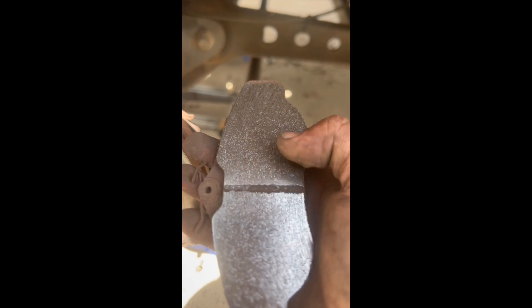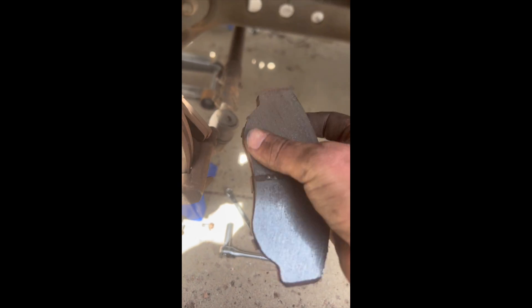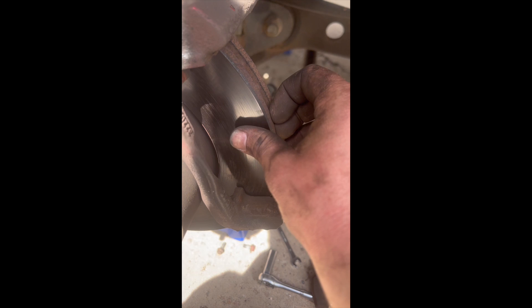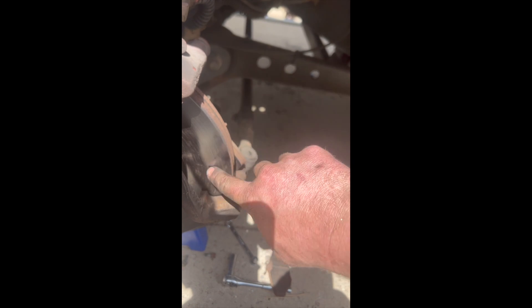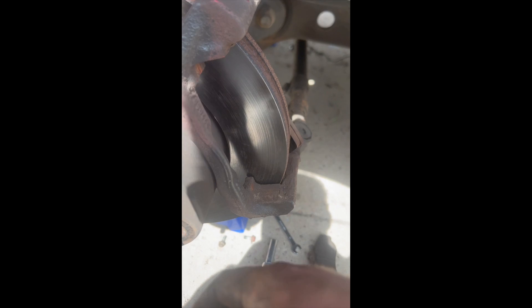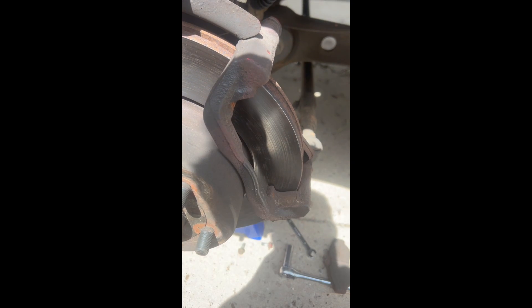I don't know if this is required or not, but on the pads, you can kind of tell if they're worn out. There should be a little groove here — this one's almost completely gone. Once they get to that point, you want to go ahead and replace them. On the rotors, you can tell if you need new ones by grabbing this outside lip here. If there's a lip, mine kind of still has some space. But I got slotted and drilled rotors, so I'm going to throw those on because I like them better. Even with rims that have a wide spoke, you can reach your finger through and pick at it — if you feel a pretty big lip and it's scraped up, that's when I replace rotors. Whenever I buy a set, I just do them all so I don't have to worry about them for years.